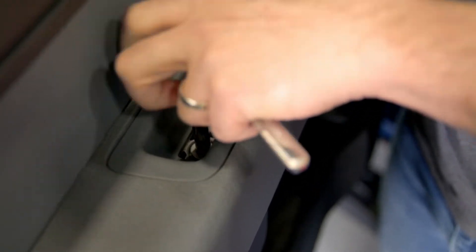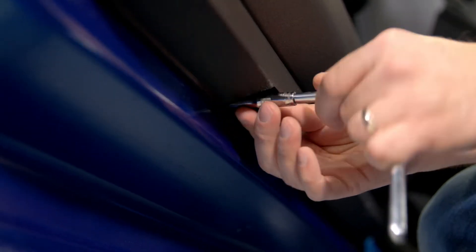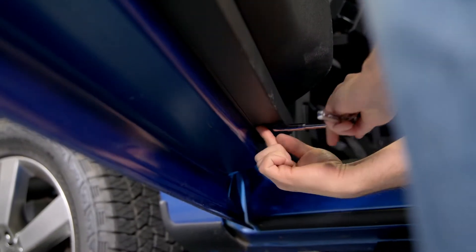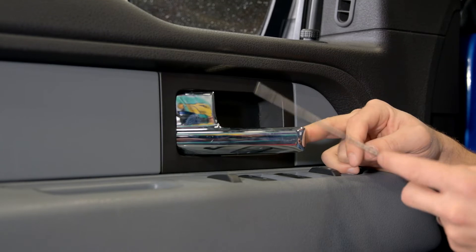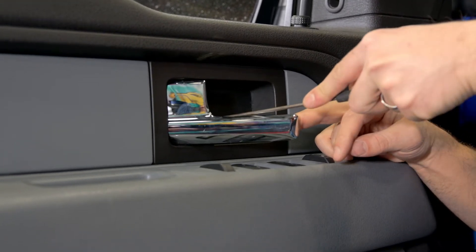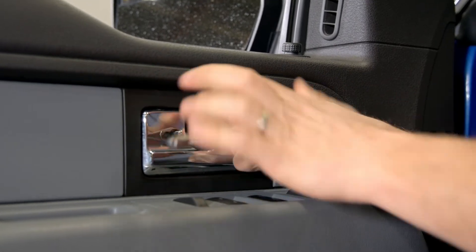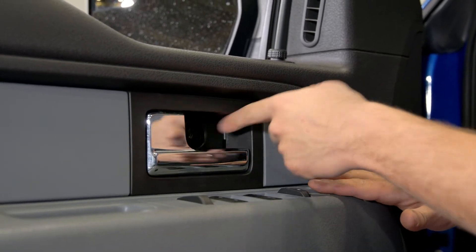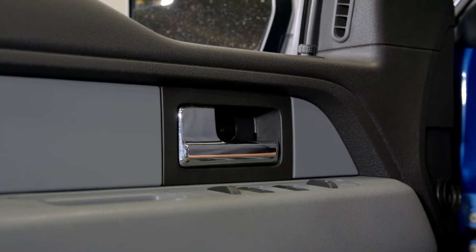This one's going to be an eight millimeter — I'll remove that right now. In this truck there are two more screws at the very bottom of the door panel, six millimeters, that also need to be removed — one on the outside and one on the inside. An angled 90-degree pick is probably the best tool to get behind and pop it right out. A lot of interior door panels are going to have these little covers hiding screws, including behind the interior handle, so look out for those spots.